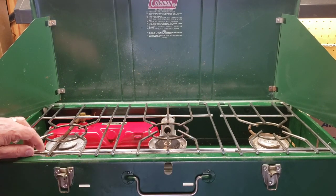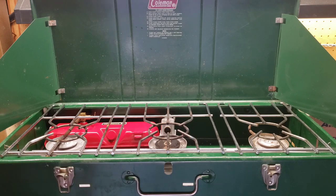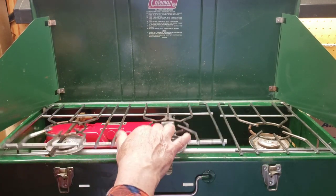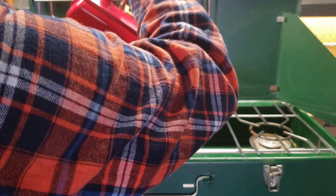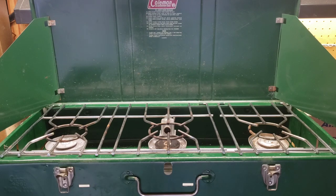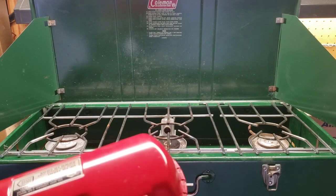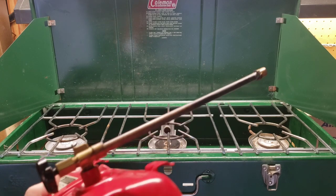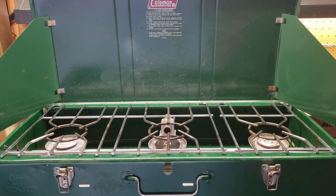Here you've got to look at the inside. You've got a valve on this end to control this burner, a valve on this end to control this one, and the main burner is the center burner. This is pretty clean inside. There were a lot of very long-leaf pine needles in here — still a few. I think this guy was from California, somewhere out west. Because this tank is built a little differently, it's recessed and it's very hard to drain — it still has some old fuel in it. What we're going to do is take the pump off, pull the stem out, and start disassembly.